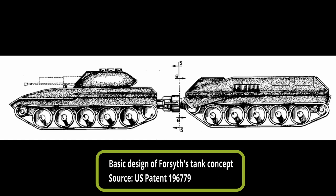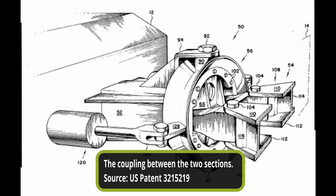The two sections were connected together through an articulated joint. The details of the articulated design would be made clear in a following application filed in July that year. The articulation was carried out by means of an assembly consisting of two rings, the outer of which has two arms connected to the hull of one vehicle, which controlled the pitch and roll between the two vehicles. The inner ring was mounted by means of an internally rotating shoe to a yoke which was fixed rigidly to the other vehicle. In this way, the coupling allowed for a controlled degree of rotation between the two sections, as well as movement sideways as encountered when steering, and vertically as encountered when climbing or descending.